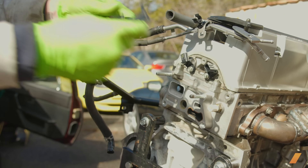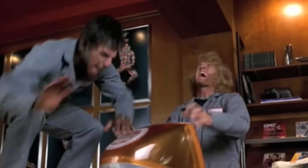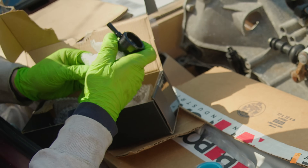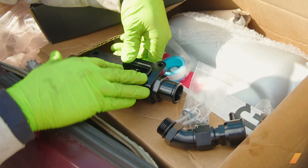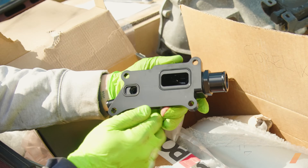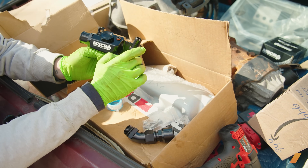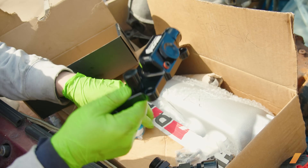That's the stock one. Take off the stock gasket. Now rip apart your Amazon packages. What they give you is some Teflon tape, a few gaskets, and new hardware. This is going to be the new filler neck housing. So we got one gasket in — doesn't really want to stay in — then we have this other one for the heater core. Just like that you've got your two gaskets. What's nice is this is a swivel, so for my heater core, I'm going to have to rig something together but this helps a ton. I'm going to wrap everything with Teflon tape just to be safe.